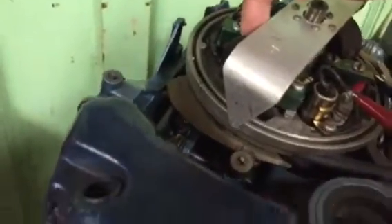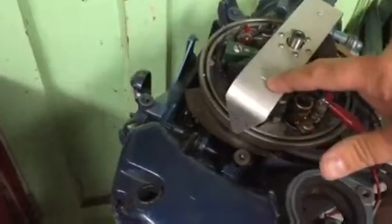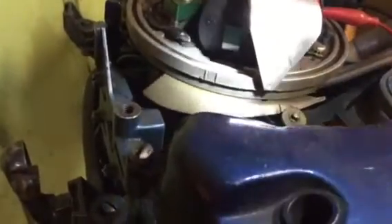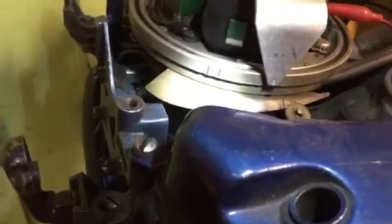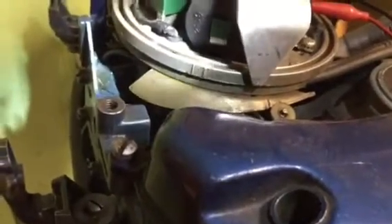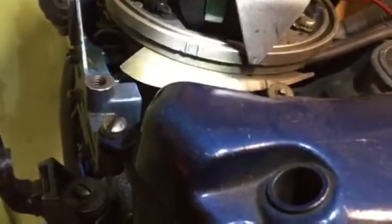This is our top cylinder — it's the coil that faces the front. You'll see the T for top and B for bottom on the timing fixture. The timing marks are here on the side; you can see them a little better with the light. Once the little line on the timing fixture hits the very first line, that's where we want our points to break — at that first line for new points, or in between those two lines for used points.